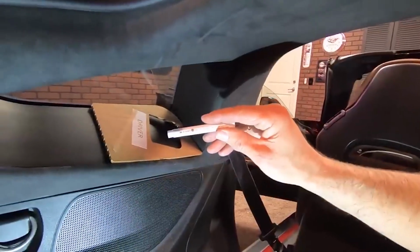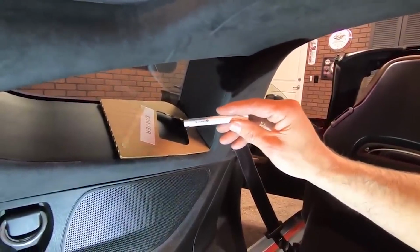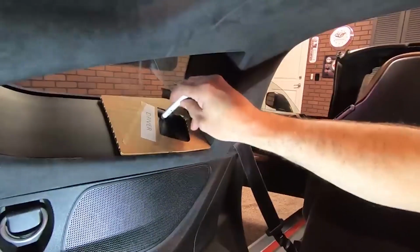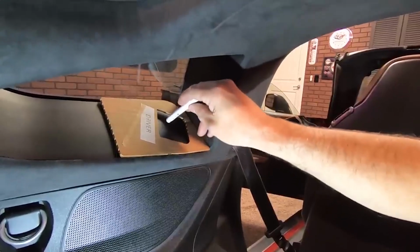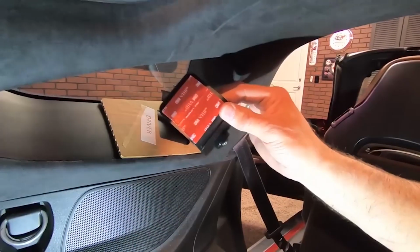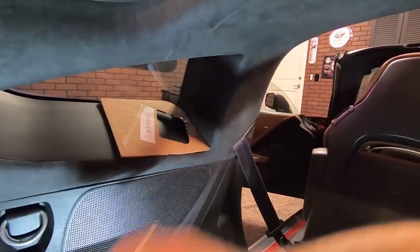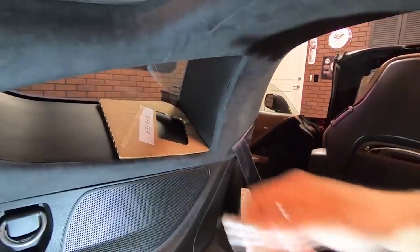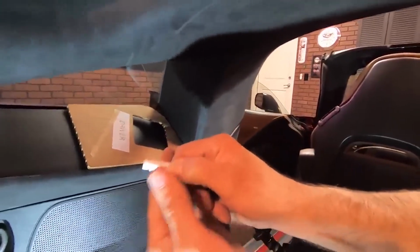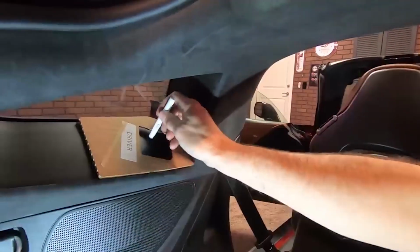Okay, so they supply us with a 3M primer pen, and we're going to use that here inside this cutout area of the template. This is used to make sure that the adhesive of the bracket itself, which is right here, is going to stick and hold in the windowsill. So you have to press this little black dot right here. You crush that. I don't know if you heard that or not. You crush it, and then at that point you can start.